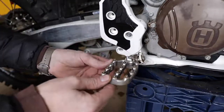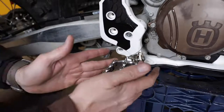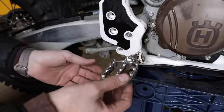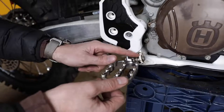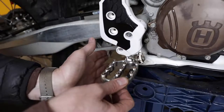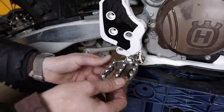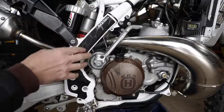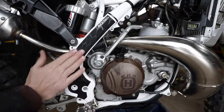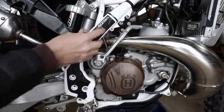One of my favorite changes is the footpegs. The factory pegs felt really small and sat up too tall. These aftermarket pegs are about half again as big, give you a wide platform, clean out mud well, and most importantly, you can adjust them to sit lower and further back. For taller riders, you can pick up three quarters of an inch back — makes a huge difference. I've also added aftermarket frame protectors with a rubber compound that grips your boots and helps you pinch in and hold the bike with your legs.